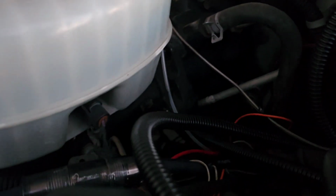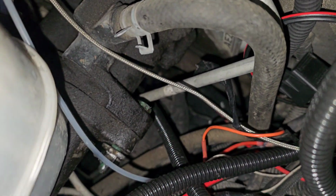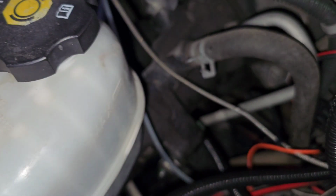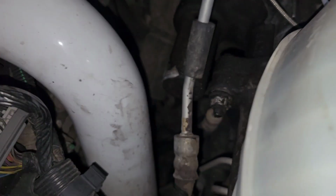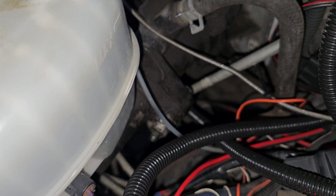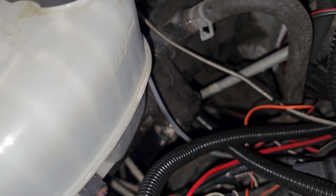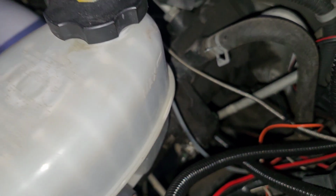All right, so I had a bit of an issue. The nut was grabbing onto the whole bolt, so I'll get a 13mm on this side to hold it, because it was just spinning. So now I got enough to take it out. Now it might be a pain, because sorry, my son's pushing the headlights. It might be a pain to put back on, hopefully, because when I did screw it back on, the bolt stayed. So I'm hoping it stays that way.